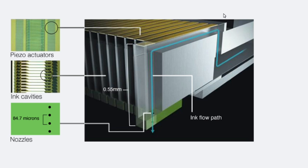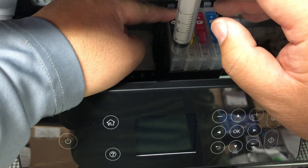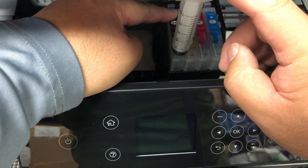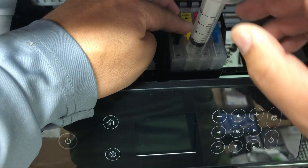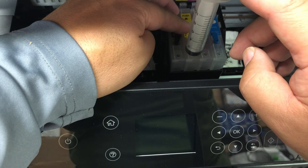If you only have two milliliters of ink and you push three or five milliliters of air, you basically push air into it afterwards. The second reason is more important. This is the inside of the Epson printhead — you push air here and the ink gets in. What you want is the ink to pass through the nozzle. The ink is housed in those little chambers. You're pushing one chamber, giving it higher pressure. If you have too much air and too much pressure, that chamber can break. That's why you should do just a little bit of air, slowly and gradually. Use another finger to hold the front of the cartridge and press the air in. Count down 15 Mississippis. To prevent breaking the chambers, you can also try doing all four together at one time — that way all four chambers have the same pressure and it's less likely to break.